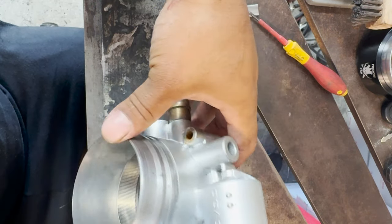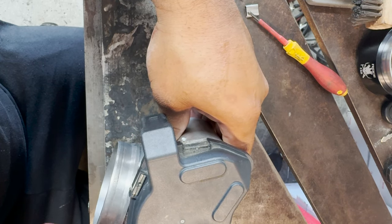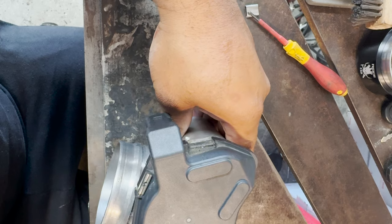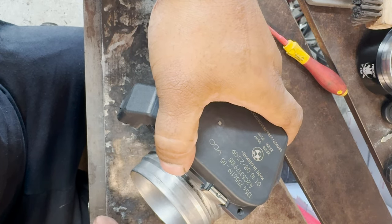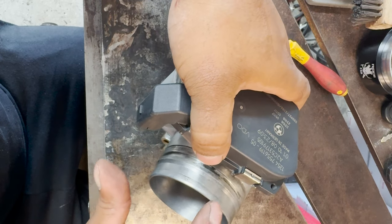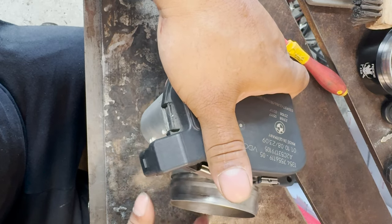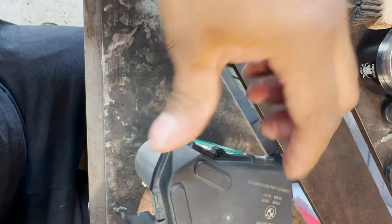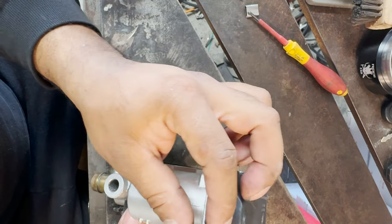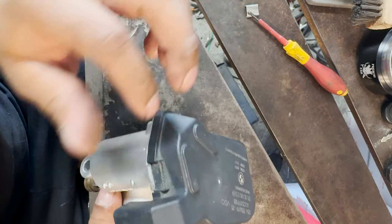But the gears and the plastic cover, some of this stuff is gonna have to get removed. The reason is because aluminum gets very, very hot when you weld it. It heats up very, very quick. And also it's gonna give us a little bit more access in this area right here to throw a nice bead down there. So around this plastic, you have these clips. I already removed some of them so you don't watch me pulling out six clips. There's only gonna be two.